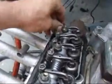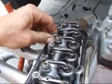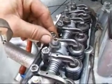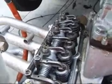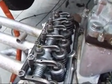I think we're on number four firing, and we have a little bit of clearance on the intake. We're going to skip this one here because we can see that one's open. This exhaust here has some clearance in it, so we'll go ahead and adjust it if we need to. We're going to check it first and see what happens.